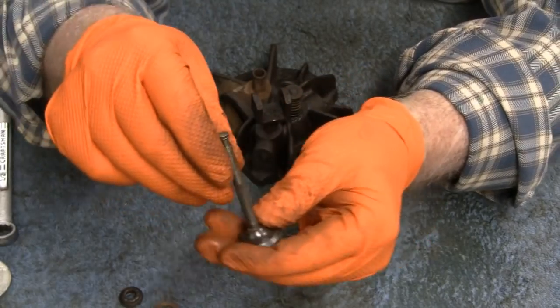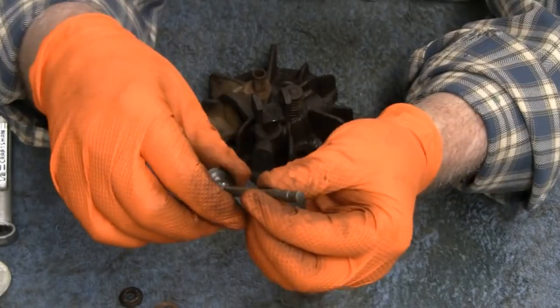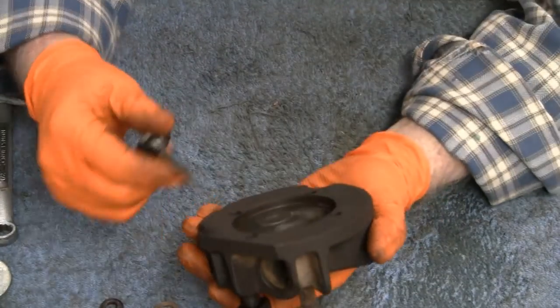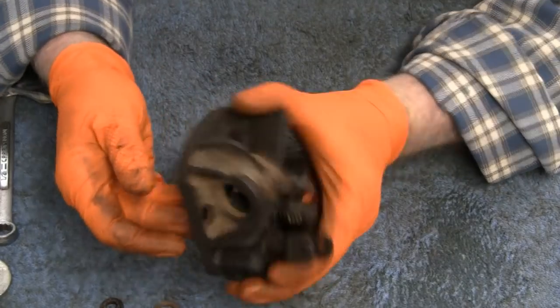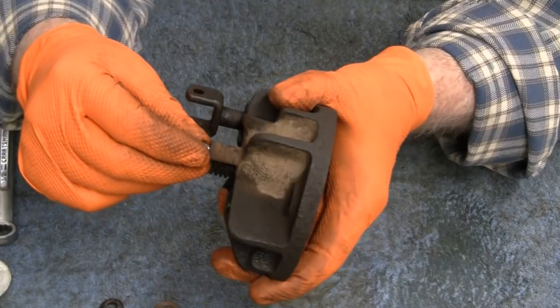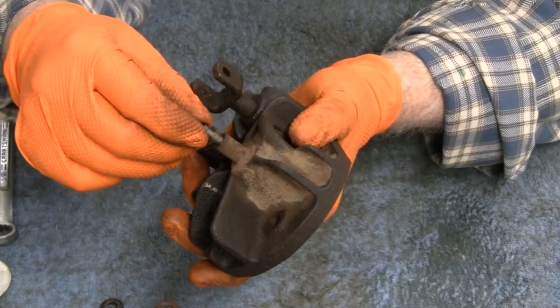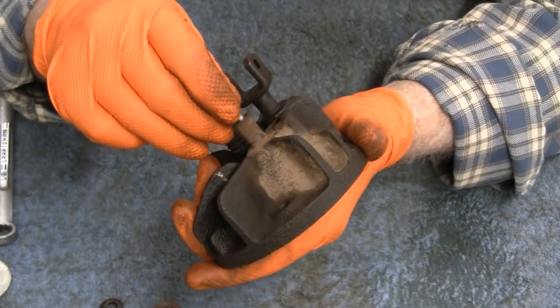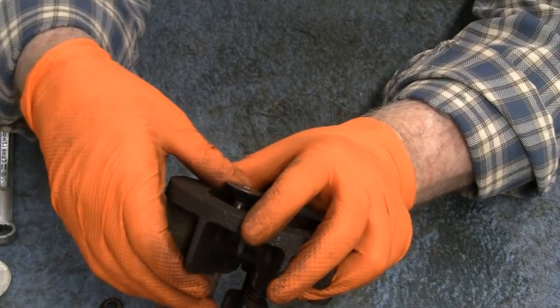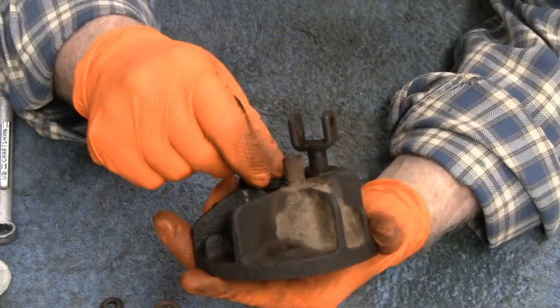The shaft was pitted a little bit and everything, but just by wire wheeling this, everything loosened up, goes right in. But it is loose in here, and if you're going to use this engine as a workhorse, then you'd want to sleeve that or put a bigger valve in, oversize that, put a bigger valve in.